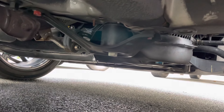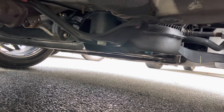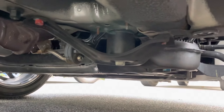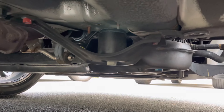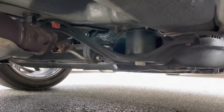I read on the forums that if you have the AC on and you don't see water dripping from underneath the car, it probably means the line is clogged. So just real quick again — 2019 Hyundai Tucson: if you have water in your passenger side footwell, it's probably due to a clogged drain line. Thanks for watching, have a good day!